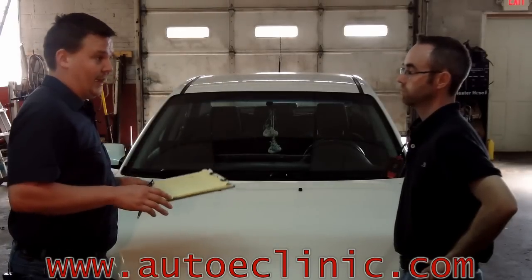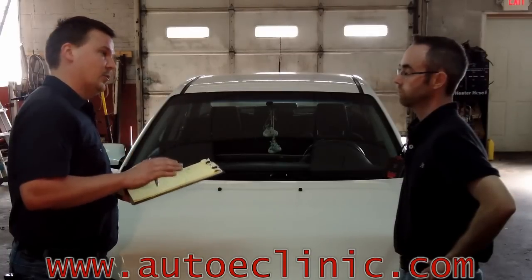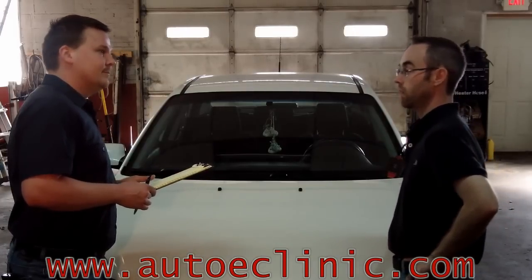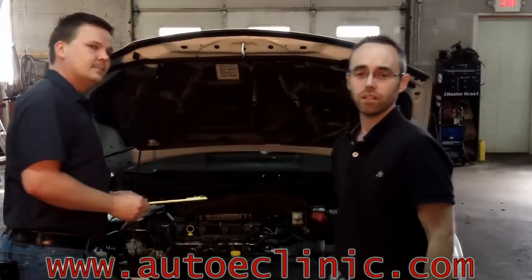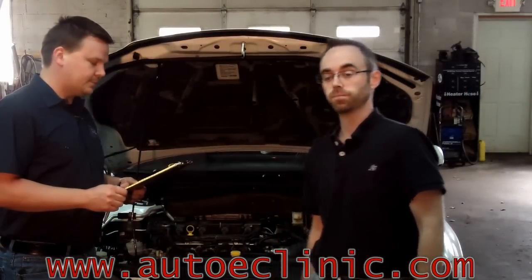And as per every manufacturer, you have to diagnose the codes in order. First code first, second code second, in order to get the accurate diagnosis. I got you. Well, let's get started on the P0455 and go from there. Great. All right. A P0455 code simply states that there's a leak in the Evap system.